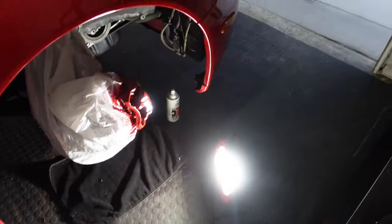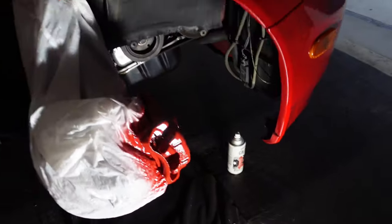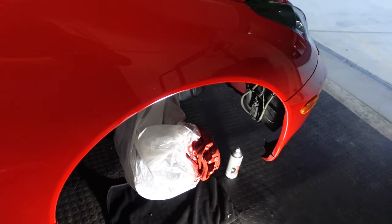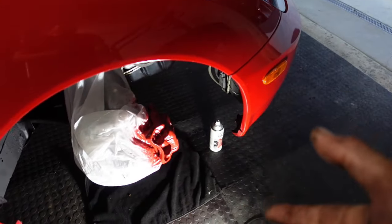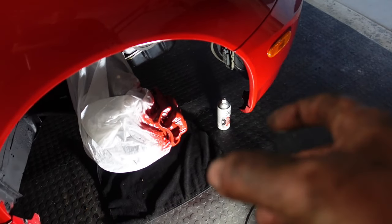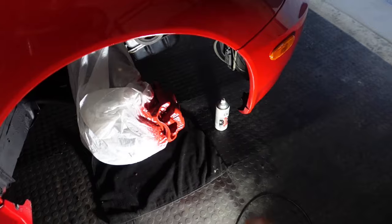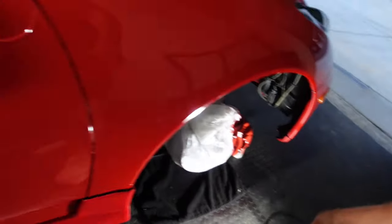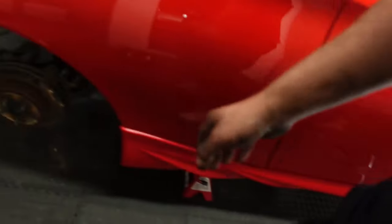Looks great. We're on the driver's or passenger side. Two 17 millimeter bolts. Replace those out, and then just slip on those pads. This is a pretty easy job. I love the brake calipers. This is a very satisfying thing. Make sure that you crawl on your back and get the backside of it like I just did. You're going to get dirty. We will let those dry overnight.